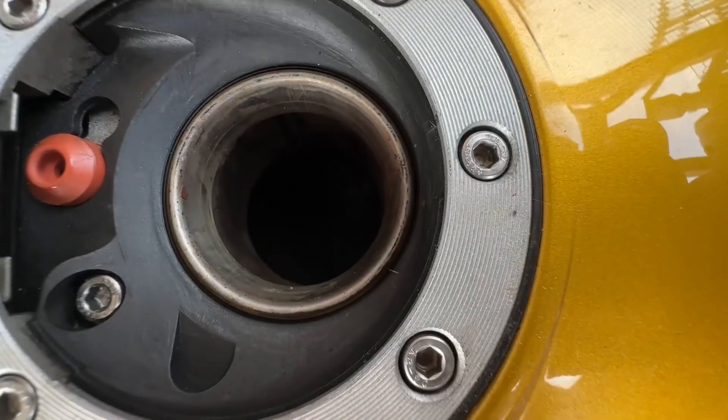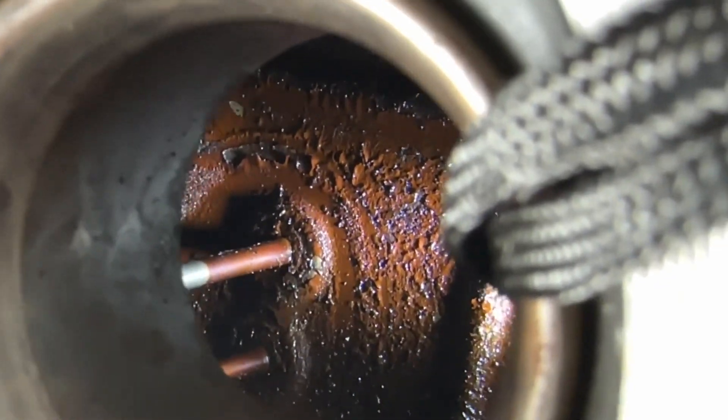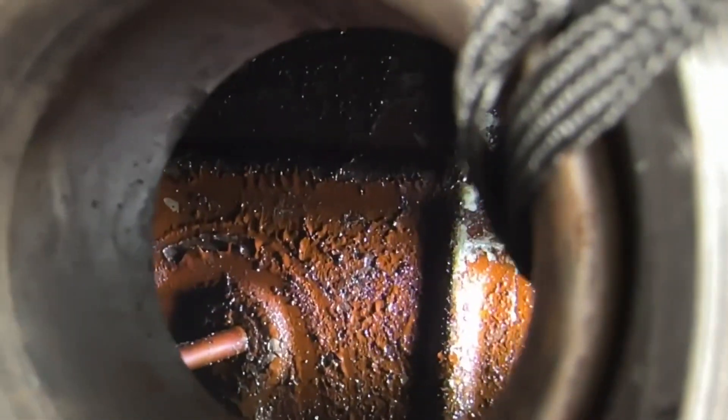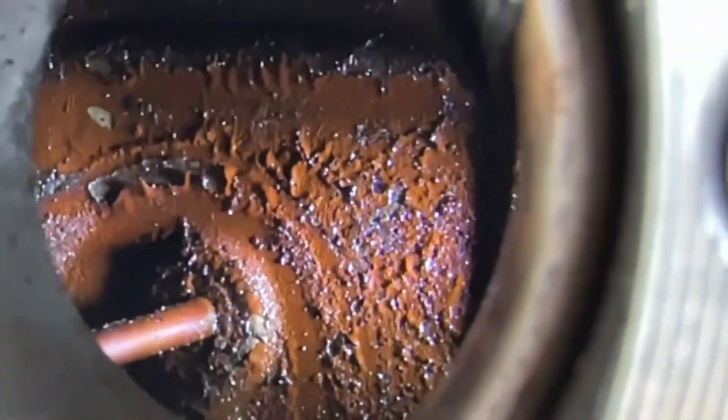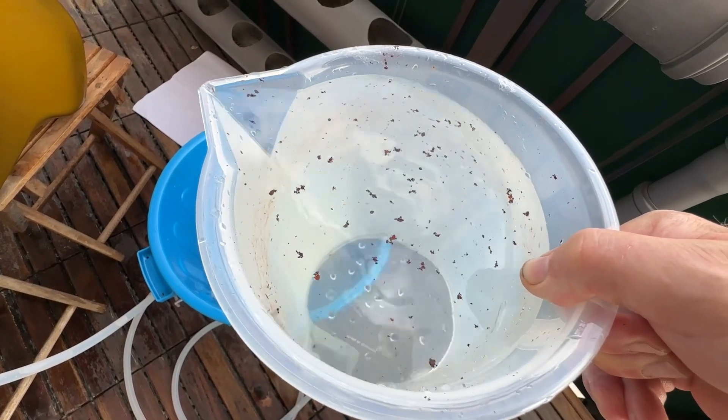Right now it's all sealed from this side. If we're looking into the tank hole here — the inlet — you can see a little bit down there; it's kind of red. Those are the ventilation tubes there, and there are rusty flakes. This is the bottom side — I scratched a little bit with a screwdriver and you can see it's not that much in terms of deep rust; it seems like it's mostly surface rust. You naturally don't want this to go into your carburetor, which is why we're doing this rust removal today.